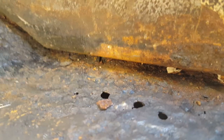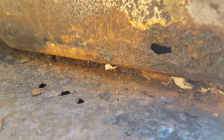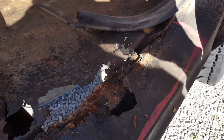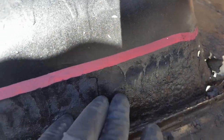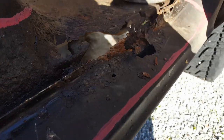I've chipped out all the seam sealer I could - it's really thick in there. They've also got a spot on the sidewall that's blown out, but I think my floor pan is going to cover over that, or at least replace it. When we get out here, this outer rocker, as it's called, is just gone. This whole thing has problems - it's rusty here. This is actually the seat base, and it's blown out. This fence that holds the seal in is just totally gone.